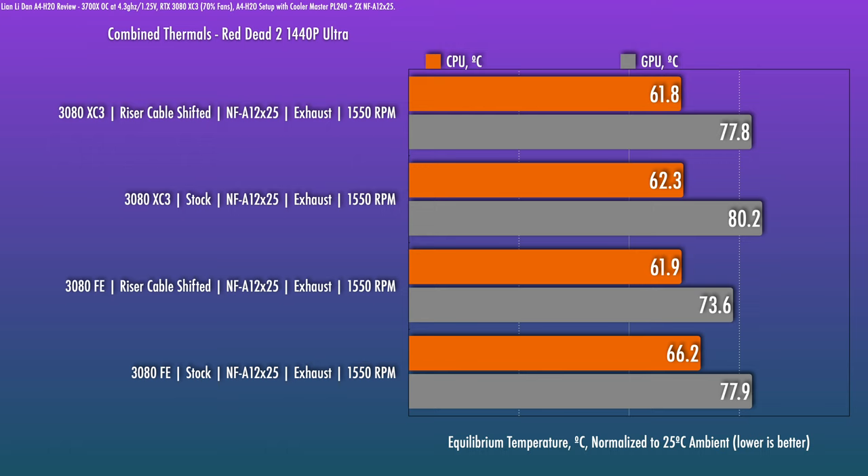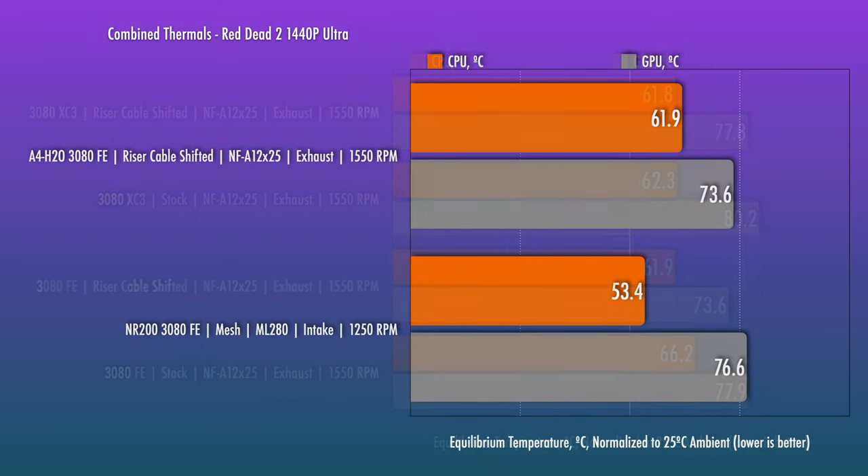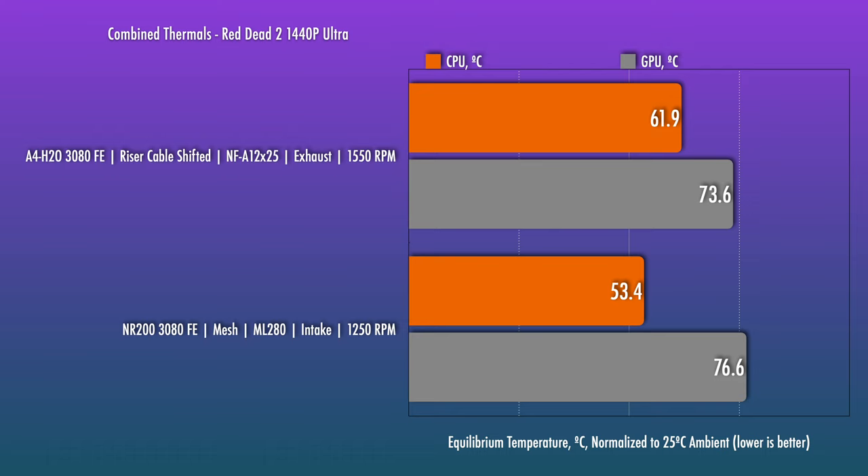There does seem to be an impact on the radiator resulting in higher CPU temps in that configuration, so spacing out the card is still better on multiple fronts. The result is not only acceptable performance in this case — it's actually really, really good for this card. The CPU temps aren't nearly as good due to the radiator having to run as exhaust, but next to best-in-class thermals, it's getting better GPU temps here. Definitely impressive by this case — I wouldn't hesitate to run a two-slot FE card in here. Just make sure you space out the riser cable.